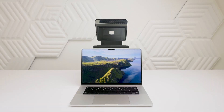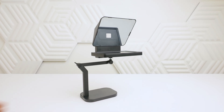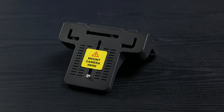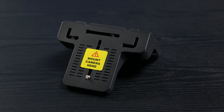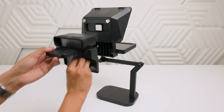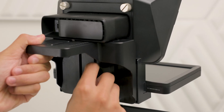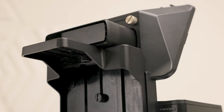If you later want to point Prompter and your camera left or right, we would suggest moving Wavedesk Stand as a whole. Next, attach Facecam Pro onto the L-bracket using the included screw. Pay attention to which side you're attaching the camera and note the sticker on top of the L-bracket. Leave Facecam Pro slightly loose for adjustment later. Attach the L-bracket onto the back of Prompter by lining up the sides and threading the screw, then slide the L-bracket up and Facecam Pro into its backplate, and tighten everything down.